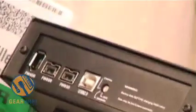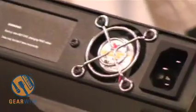Striping allows the two drives to show up to the computer as one device, and spanning allows both drives to show up as one, and when one drive fills up, it will then start to fill up the other drive. JBOD allows both drives to show up as individual devices.